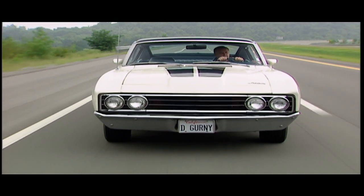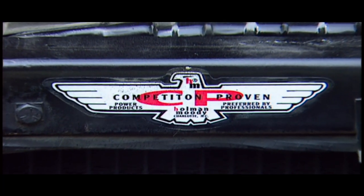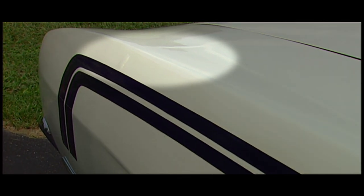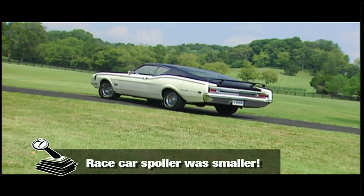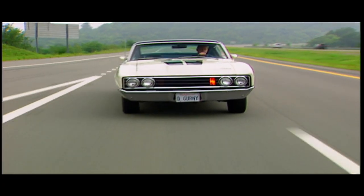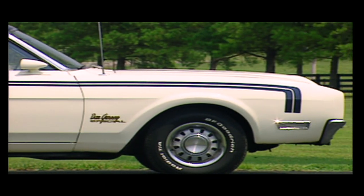Dick Fleener's Spoiler 2 is one of about 90 that are still running. There's the Spoiler 2 and the Spoiler, and this is the one they built specially for NASCAR — very limited production, special body mods. The Spoiler 2 was all about the body: it had to be low, it had to be aero, and it had to be done fast. A 19-inch extension on the nose bent down for better airflow at high speed and welded in a hurry — you can still see the seam. Front grille from Ford's NASCAR Torino with a rubber gasket all around so the air would flow just a tiny bit better. A Torino rear bumper sat up front on the Spoiler, chopped up into three pieces and welded up to fit. Out back, a full-width spoiler made from the finest of plastic — totally useless until you're doing at least a hundred. Turn signals out of a Ford van — you don't need them on a race car, they just stuck in whatever was handy. The Spoiler 2s even had the rocker panels rolled under a little further, just so the car could sit a tiny bit closer to the ground. They then had to reshape the fender so it would match the rocker panel.